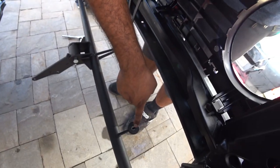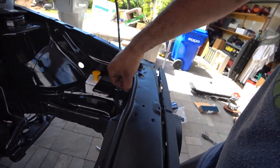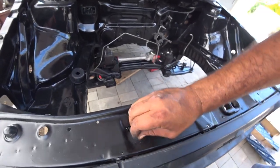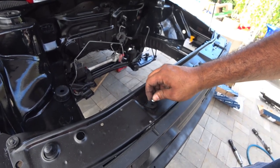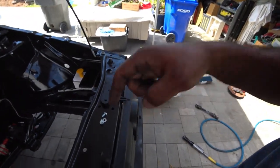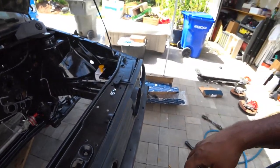You can see here — here's the radiator support for the lower portion, and then up here we've got these little brackets. I haven't installed them all the way, they're just hand-tightened. There's one bracket for this side and here's the other one. They have sliders on here because you have to pretty much slide the radiator until it lines up correctly, so we're going to work on that next.